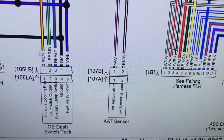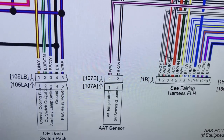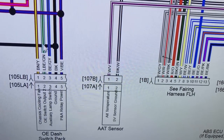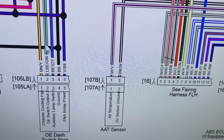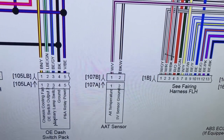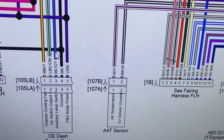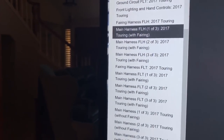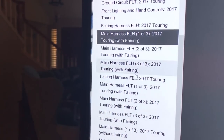Here is the green wire which, on the left panel, operates the middle switch. It's good for two amps — that's where I have my fog lights, which draw about 0.7 amps. Then this one is to turn on the passing lamps, the auxiliary lamp switch. Note the color of the wires there.